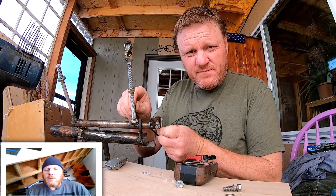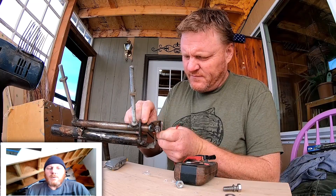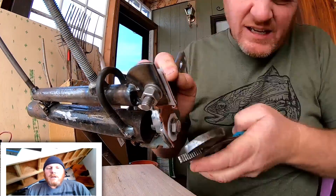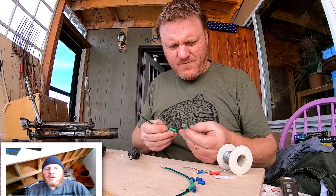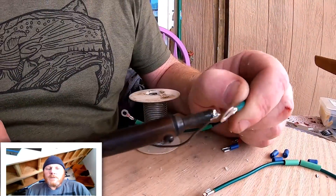I'm showing you how to insulate them here — I just used a little plastic off the back of a caulking tube. Testing them for continuity, making sure they had no continuity, is important so they don't ground out to the airframe. I just bolted them together.